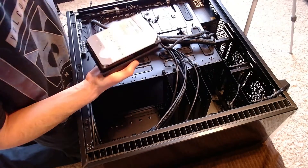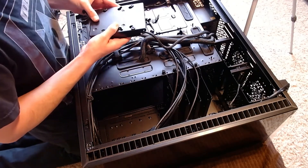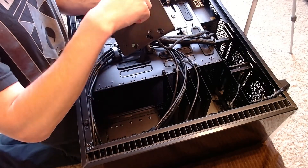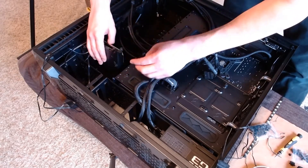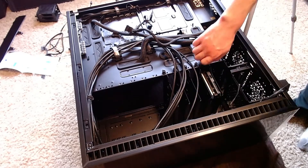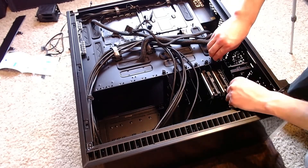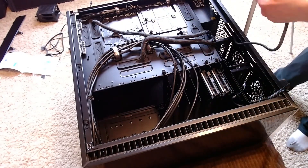Next I position the hard drive into the cage correctly. By this point, we have gotten really good at screwing — there are four to install like the previous plate. There is no reason to go fast; take your time and go slow. Once everything is attached, we replace the mount back into the slot and secure it. The mount clips to a hook underneath and then is fastened at the top. The second hard drive gets installed to the case the same way.